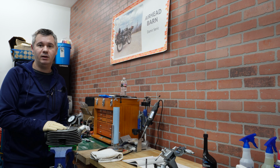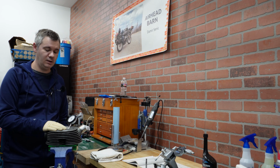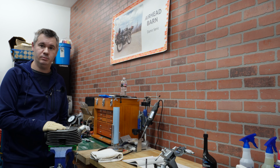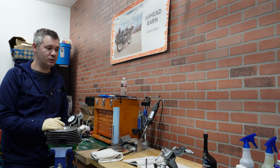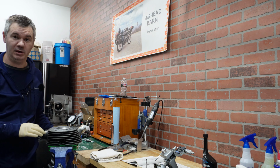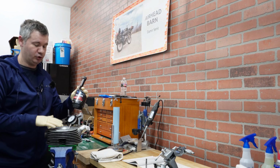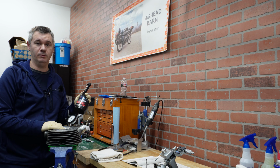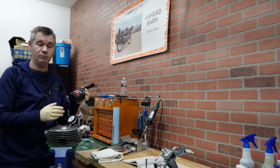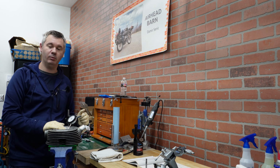Previously I used different techniques to clean that carbon buildup from the cylinder heads, from the combustion chamber and also valves, and this time I used Techron Complete Fuel System Cleaner. One bottle was plenty to soak the combustion chamber and also pistons, and this thing worked pretty well. I left it for that carbon buildup to soak for a couple of days.